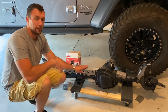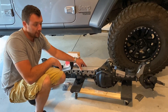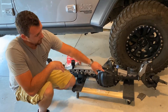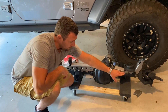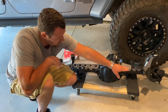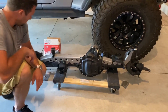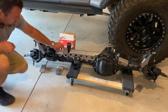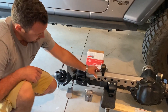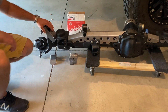As you can tell, with this new Apex axle truss from Artec it is pretty easy to fit on here — it kind of fits together nice and snug, everything indexes nicely. This is an industry first for trusses: they actually continue the truss all the way to the end of the axle C's with this under-the-spring coil section. It also comes around and hugs the FAD — the front axle disconnect — so that'll tie all that together, as this is where these axles are the weakest.